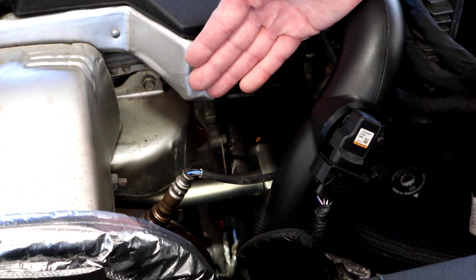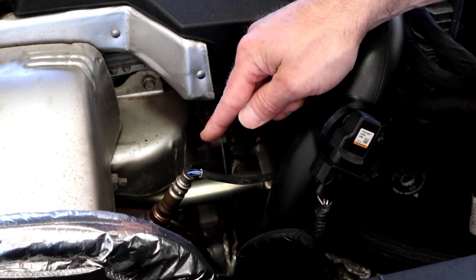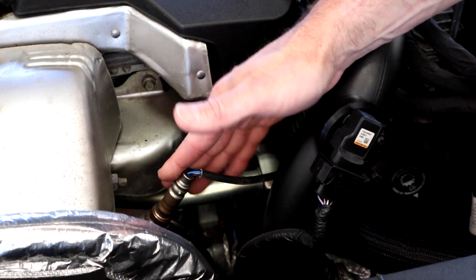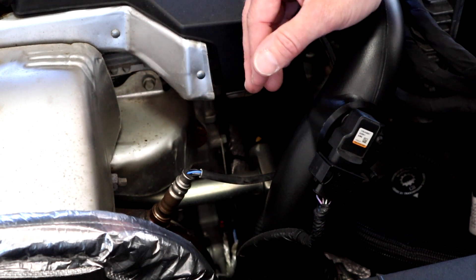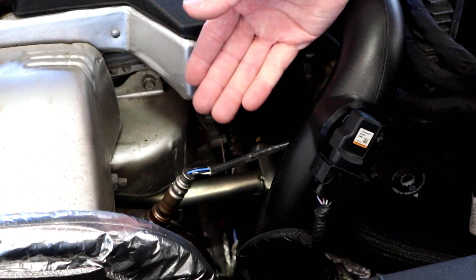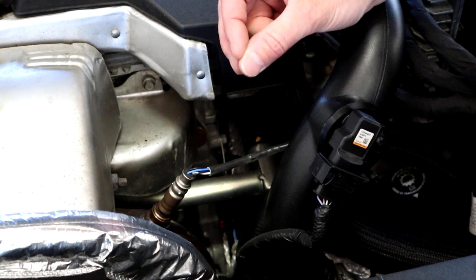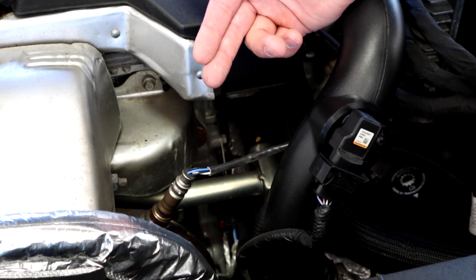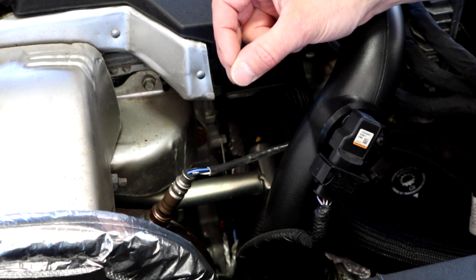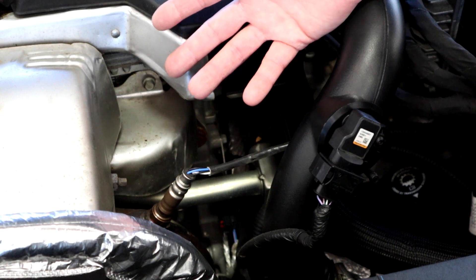With the general explanation aside, let's talk about the different types of oxygen sensors. We're not going to go into a lot of detail about construction, but more practically about outcomes and what we look for. Oxygen sensors by name generally have a zero to one volt scale. Some sensors go to five volts, but most of those five volt sensors we refer to as air-fuel ratio sensors, and we'll do a separate video on that.